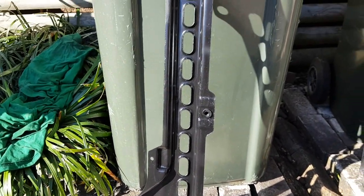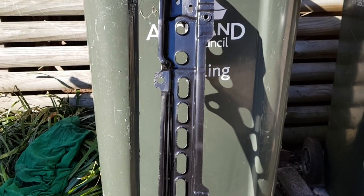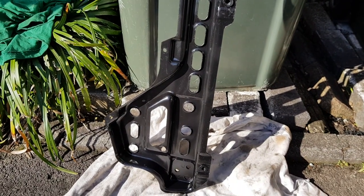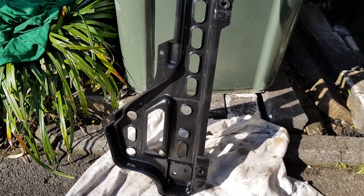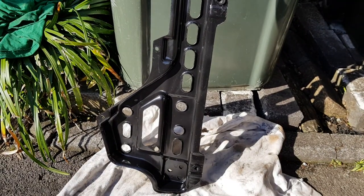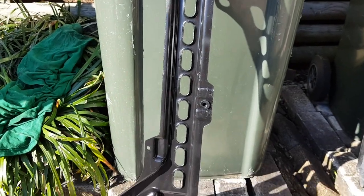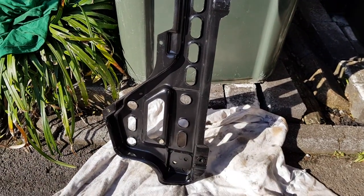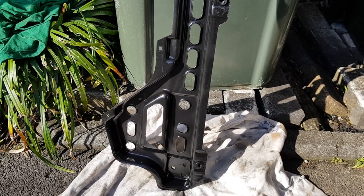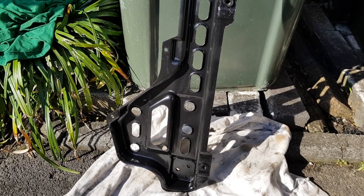It looks like the original paint wasn't really that great, so I don't think this is going to corrode anymore — it's really just a preventative measure. To recap: I just brushed the rust off, didn't even sand it, then did the zinc spray paint. It's actually pretty easy to remove just this bracket, so if we have to do it again more thoroughly then obviously I will. But I'm pretty sure this is going to hold up for quite a long time. Thanks for watching, see you next time.